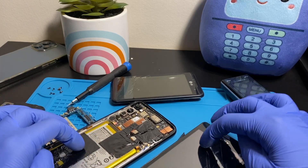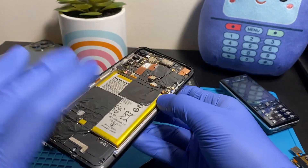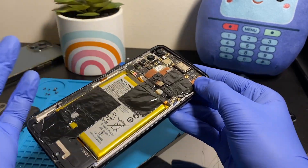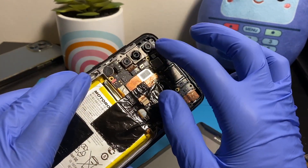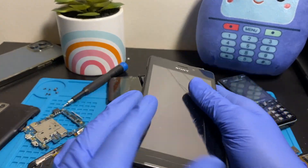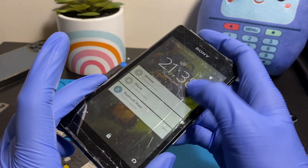These two I got to in the nick of time. This one has some permanent damage — the display is a bit dim because the replacement screen was cheap, but the phone works. A resistor came off because it was so corroded, and the microphone probably doesn't work because of that. The cameras were also taken out by the water damage — neither the rear nor front camera works, and the camera app crashes. This other phone had just slight water damage on its digitizer connector; I got to it quickly, cleaned it, and it's been working for three years.